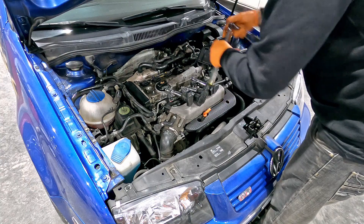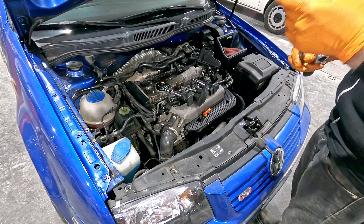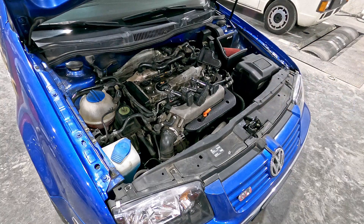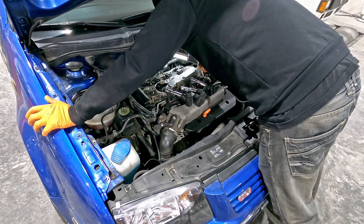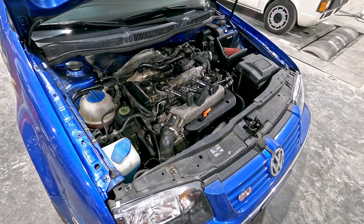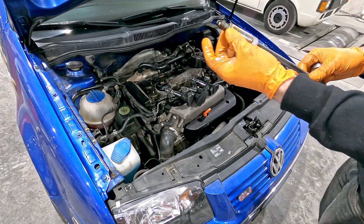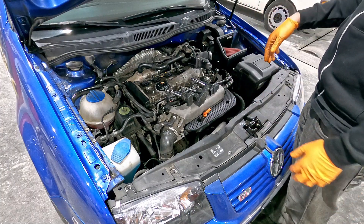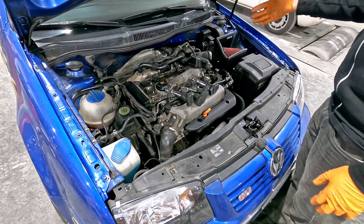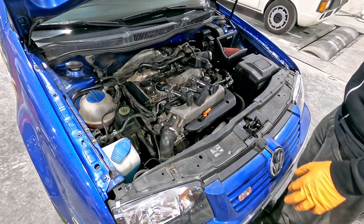Clearly needs a new gasket. The same results on this one — this one's actually soaked. And on the last one I can see oil on top of the spark plug before I even pull it out, so it's definitely been leaking for a while. The socket and the plug are both covered in oil. It's not a big deal, but over time it would get down into the cylinders and start burning oil, which kills octane and kills horsepower. When it gets reassembled we'll make sure to put a new gasket all around on the inside and outside to make sure no oil is leaking down.